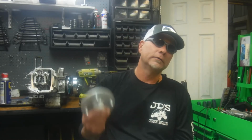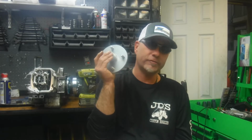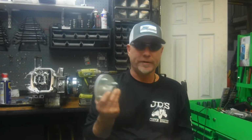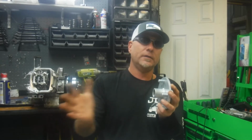Now, back in the day, when I first got into this 10, 11 years ago, I wanted to put hubs on the spindles of my Earth Dog. 4 on 100, or 4 on 4 inches, because 100 millimeters is 4 inches, was the only size you could find. So what I had to do to use ATV wheels is buy a wheel spacer adapter that was 4 on 110 and adapted it to 4 on 100, or 4 on 4 inches. So I had it set up like this. I bolted on a spacer, it changed the lug pattern to 110, and put on my 110 wheels.